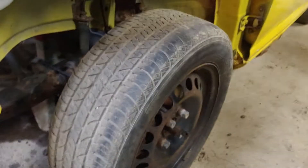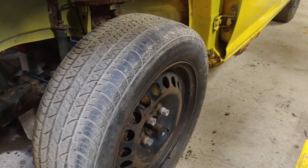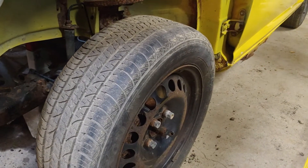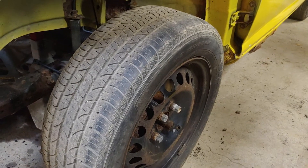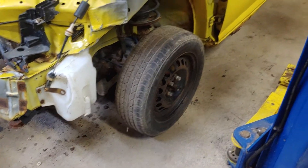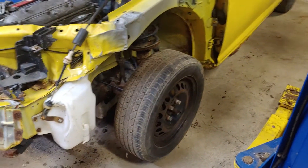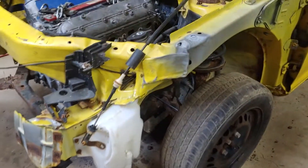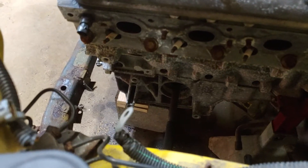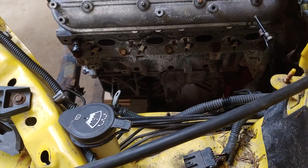3.73 or 4.11 gears are going to mean that at highway speeds the engine is going to be screaming. I'd like it to lope along at 2000 RPM or less. I did the math and with the tires I have on here I need like a 2.73 gear set — that's actually what my '69 Camaro came with in the rear. But that's not going to work for anything I want to do, and it certainly doesn't help me for the front differential. In the Trailblazer SS the front diff comes with a 4.11 gear set, which is the worst possible for this car.